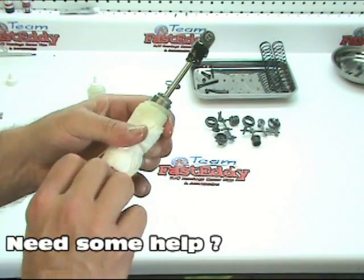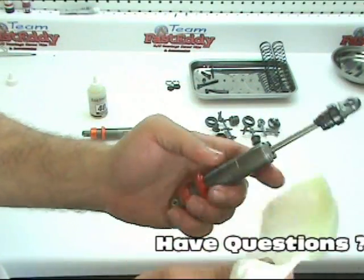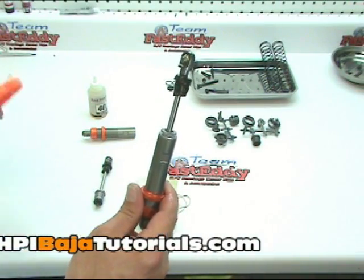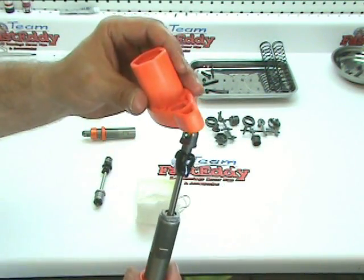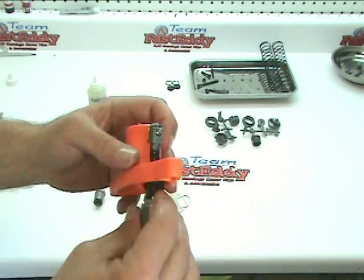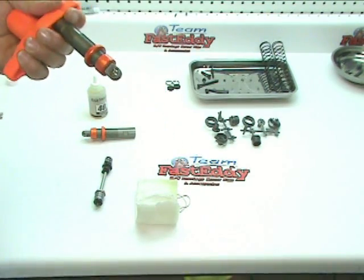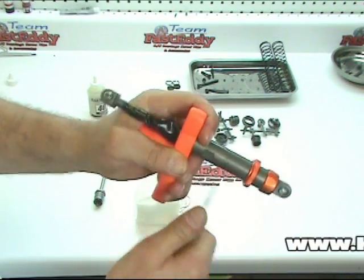The last step here is to go ahead and tighten up the bottom cap. We're going to remove our napkin and wipe up any mess. We're going to grab our orange wheel wrench one more time and slide all this stuff through the wheel wrench. There is a place in there where it catches, and we'll use our multi-tool and just snug it down. Don't over-tighten it.